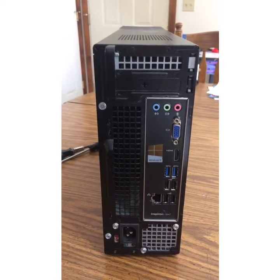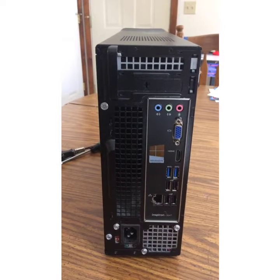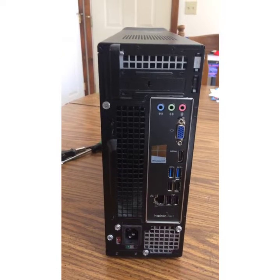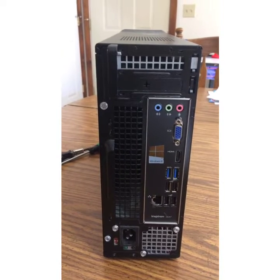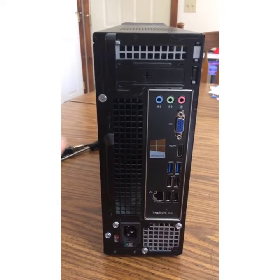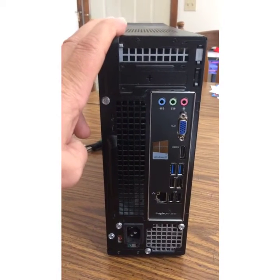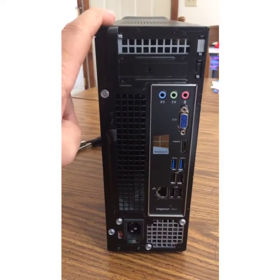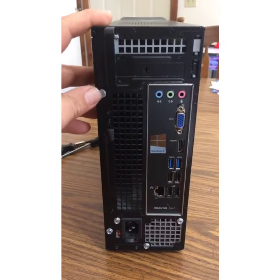So we're going to get right off by saying make sure you are grounded if you're walking on a rug and you're touching your computer, because static electricity can damage the motherboard. So I would suggest touching something metal right off the bat. Most computer cases are metal. So touch it and you ground yourself and you're fine.